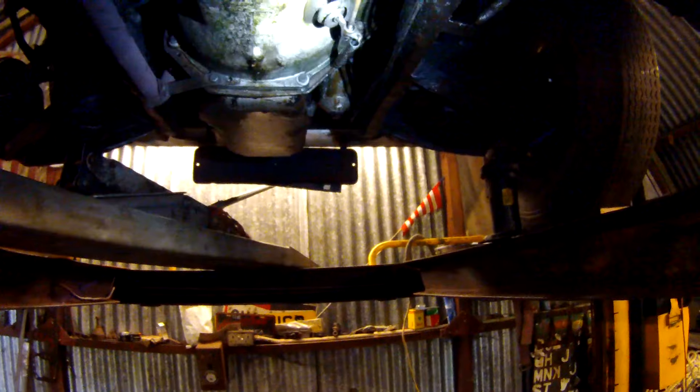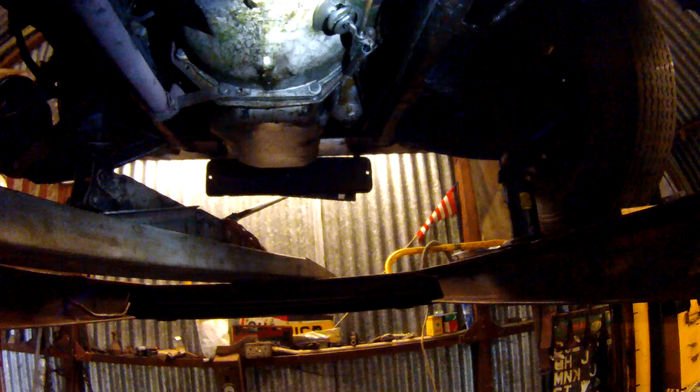The adjustment of that is quite straightforward. The sills are generally okay — there's a little bit of a problem at this jacking point I'm going to fix later, but it's not pressing at the moment. It's been pretty well protected over the years. It's still got the original smooth-case gearbox, which would originally have been intended for an 803cc, or maybe a 950 — certainly not the 1098 that's now in it.